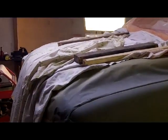I did not prime underneath. We're just going to scuff that and seal it along with the outside of the fender. Denib the dust turds that fall into the sealer, and we're going to shoot it. And of course, we're not going to shoot it with 2x4s and bed sheets sitting on top of it, but that's good enough for primer. Good enough for the girls that ride in this truck.